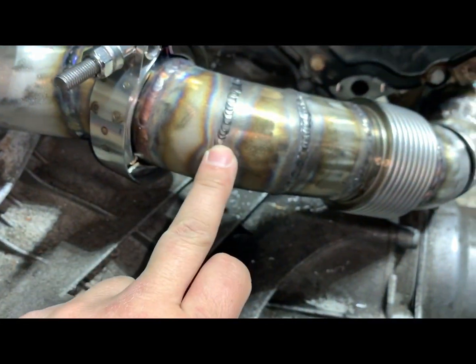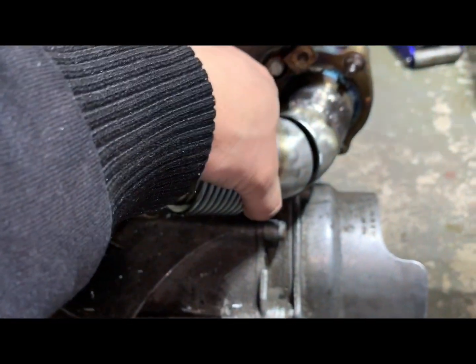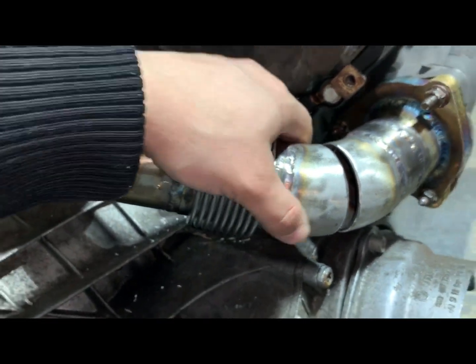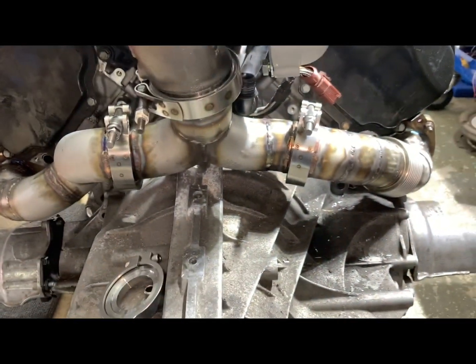It's probably because I cut it here and it shifted everything over, then cut it again and shifted everything over — probably an eighth of an inch. That's what you have to deal with. So if you think you've prefabbed everything and it's the final thing, no. Make sure you put everything back together and check all the clearance.